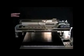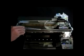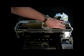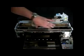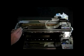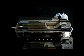Let's begin by talking about the bridge unit. This is the area that the printhead travels back and forth on. You can see the rails here — these are the rails that the head carriage slides back and forth on. In your maintenance, you'll see these need to be oiled periodically to keep a nice smooth glide on the printhead. If we look down in here, we have the belt drive, which drives the printhead carriage back and forth.